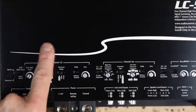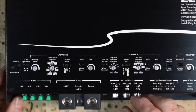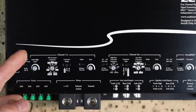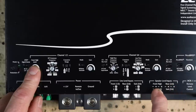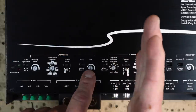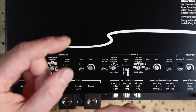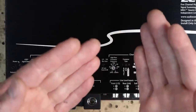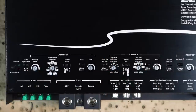The first thing on channel 1 is the gain control. If you're going to use this as a low-level input, plug those in and disregard the front high-level gain knob because you're not using it. However, if you're using high-level speaker wire inputs, that is the gain control for the front high input — it allows you to mix in that channel. You have your main gain control and this secondary control to bring the two together, letting you control the level of that tweeter channel coming into the front channel.